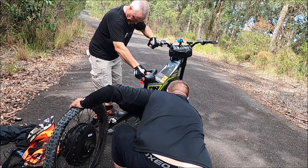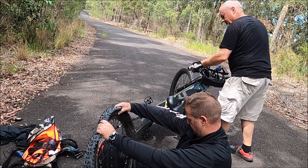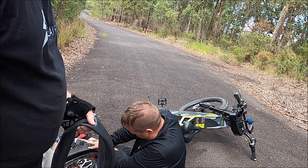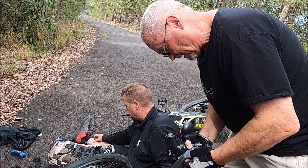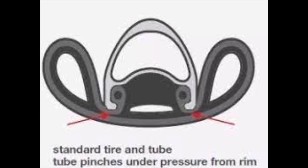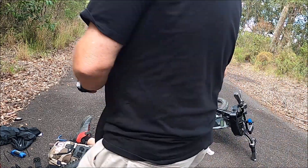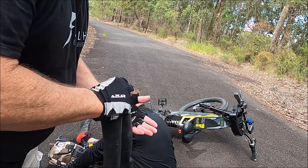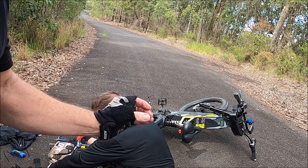Cables off, that's good. Did you say that wheel is ten kilos heavier? Yeah, ten kilos heavier. It's a pinch flat - we've got a double slit in the tube where my thumbs are. So we got a pinch flat coming down those rocks, and that's the one thing we were actually afraid of with the heavier wheel - the force hitting the tire. You did say you had the tire pumped up a little bit harder to try and offset that squashing effect with the heavier back wheel.